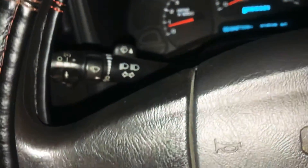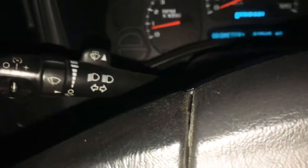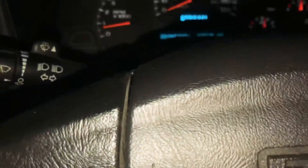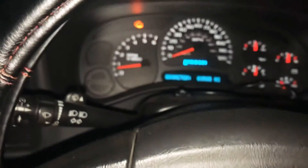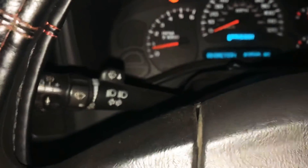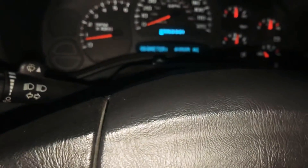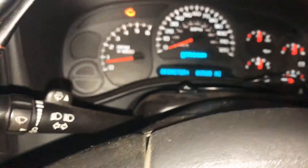It's pretty simple — you just take the dash apart a bit. There's a blue wire in there, and when you connect the other wires for the windshield washer and the blinkers, you just connect that blue wire up and that's the cruise control module. These are all drive-by-wire since '99, so it's pretty simple — you don't have to do any work on the throttle body because it's all controlled by an electric motor.